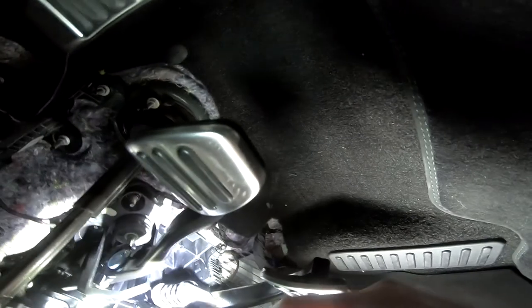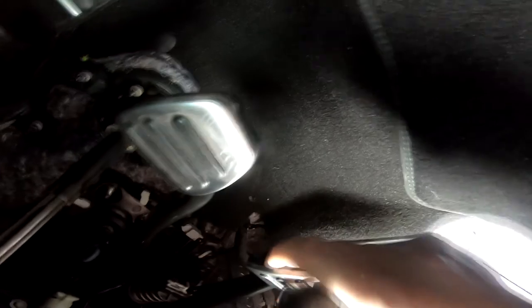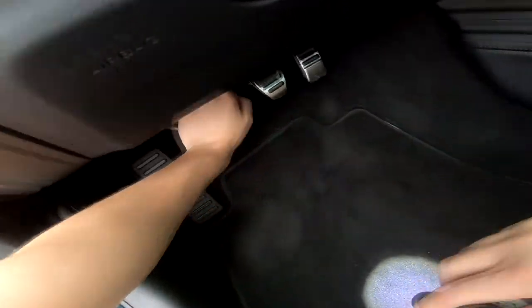Here's the assembled portion — I'm going to get under the car and install it. Five minutes later, the spring is back installed. I put the left side of the spring in first, pressed the pedal down, and was able to compress it right into the perch. It feels a lot stiffer — I'm interested to take the car out for a drive and see how it feels.